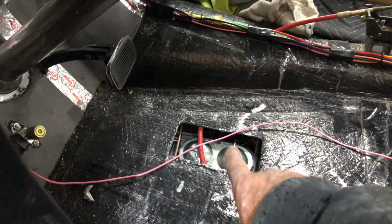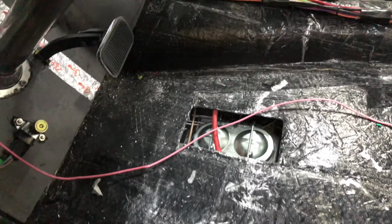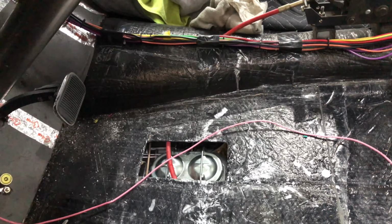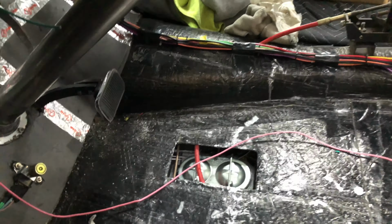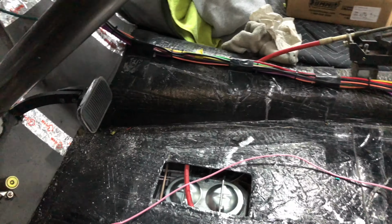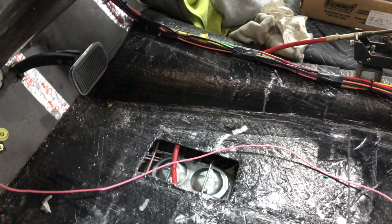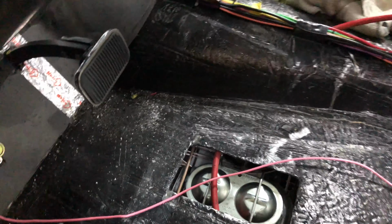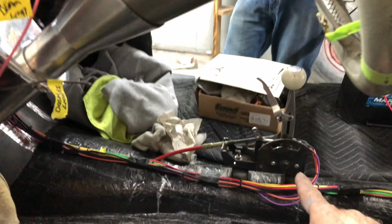And here's an interesting thing that we worked out this week. We had another master cylinder in there, and for the life of us, we couldn't get the brakes right. We got the brakes bled, but they were spongy, wicked spongy. We worked out that the original master cylinder had a 1-inch bore. So we went up to a 1 1/8 inch master cylinder, and that was our problem. The pedal stroke was really long as well. That worked out really, really good. So now we've got good brakes, excellent brakes, says Steve. Shifter's all connected, everything's bolted on, the roll cage is in.